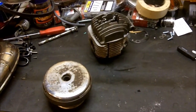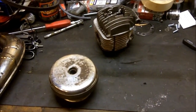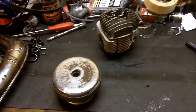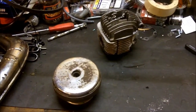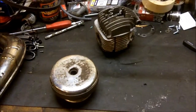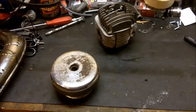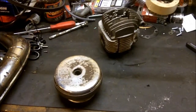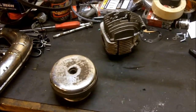For starters, I'll give you a little bit of insight on what I'm working on. Basically, my Moto Becane just kind of died on me when I was riding one day, and I had a lot of trouble getting it started. It's kind of confusing because right around the time it died was the same time I put a new CDI unit on it, so I thought maybe it was — I was pretty certain it was something to do with the CDI — but I had good spark, set the timing a bunch of times, and still no luck. I ended up tearing everything apart, and here's kind of what I found out, but I thought it'd be a good time to talk a little bit on how decompressors work.